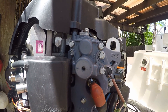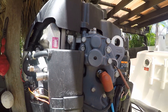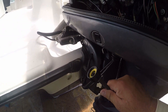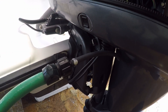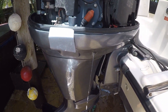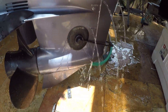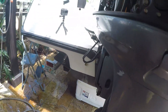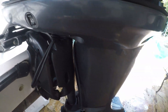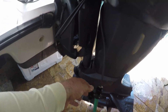Put your comments below with your suggestions or what you know about this, because my guess is that water cannot flow through when the thermostats are closed and the motor is not running up to temperature. Anyway, this hose is very practical — you can do it when your boat is in the water and flush and run fresh water through the engine. Just remember, once you're done, put that hose back in its place in the motor. You don't want to leave it hanging — that's not a good thing.